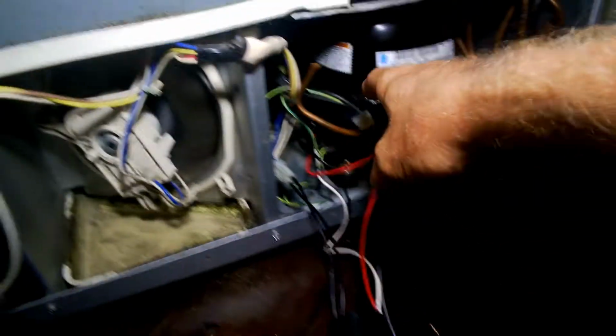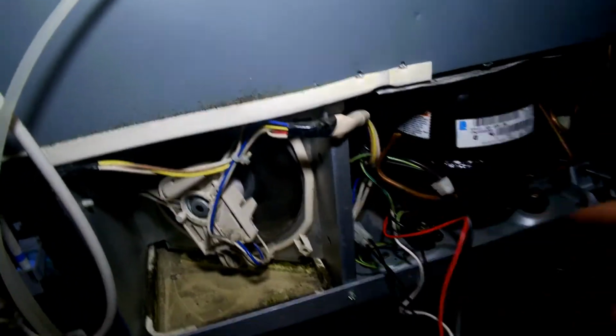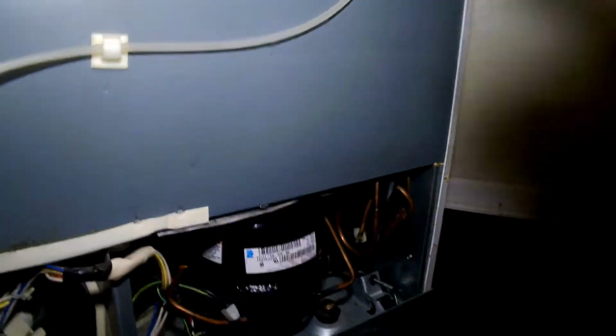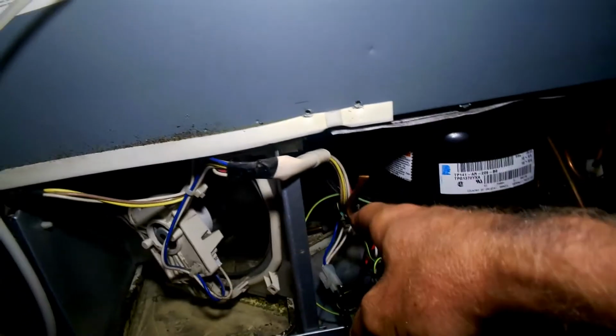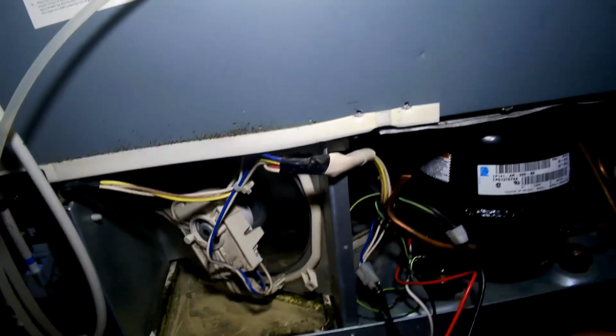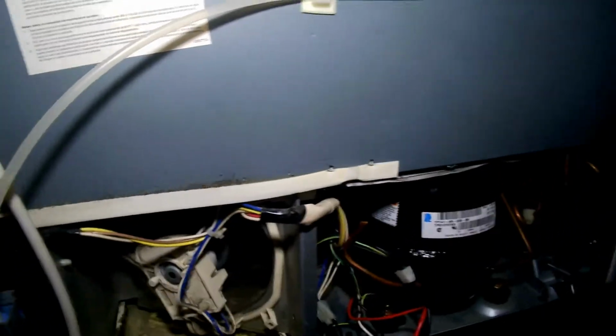See, the stuff gets pumped in here, it comes out, goes through those, gets cooled down, then it does all its magic through the different size pipes and whatnot when it gets colder and colder. But if it comes out of here and those condensers are all stuffed with stuff and the air is not pulling across them, they're just getting hotter and hotter and hotter. And at some point we had a compressor start failure.